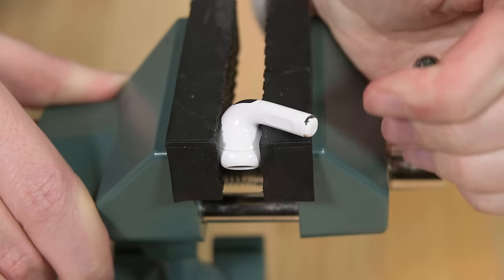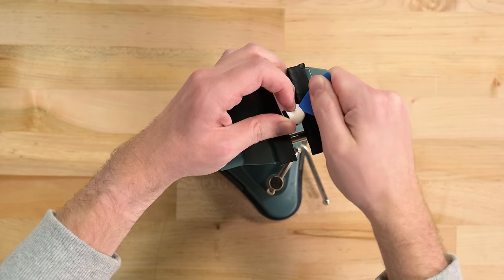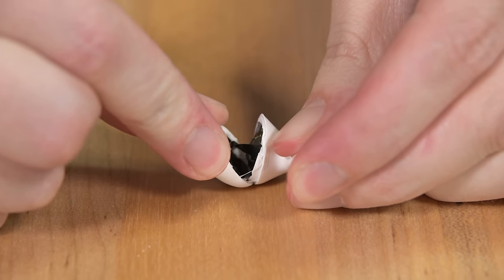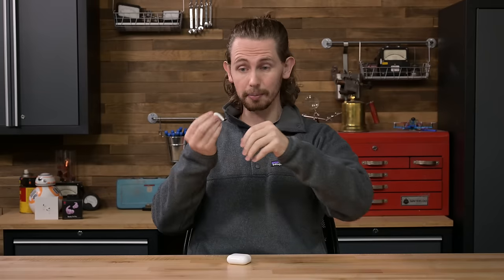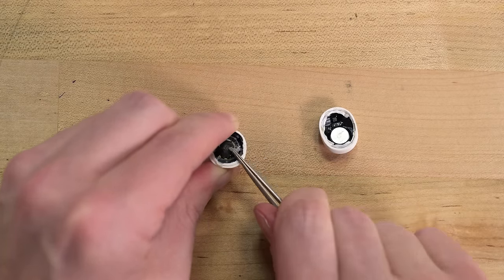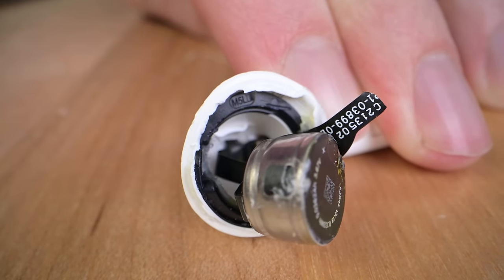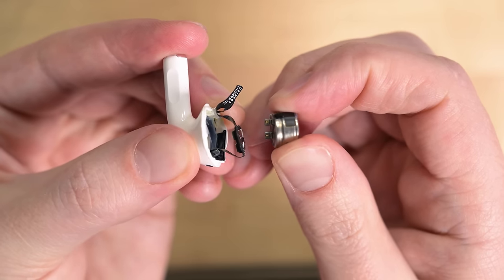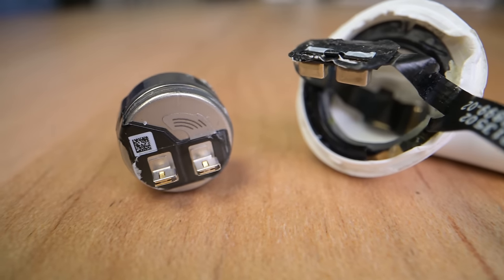While we're talking about batteries, let's hop over to AirPods real quick. These are interesting — the AirPods 3 require more clamping force to separate, and the plastic is more easily deformed by my opening pick. Inside, I'm met with a similar mess of cables, one of which I accidentally snapped trying to get this shot. But there's some good news. Under this adhesive, which I can remove by carefully twisting it around a pair of tweezers, I can pry up the battery, which appears to have a complicated connection to the cables underneath it. But after some careful separating, you'll see this button cell has a built-in plug. These two prongs slide into sockets on the flex board underneath the battery like a tiny plug. This is honestly pretty clever.